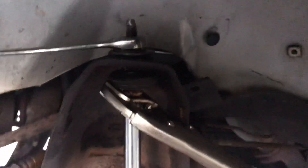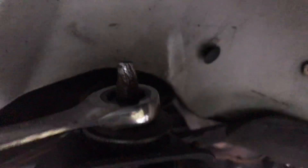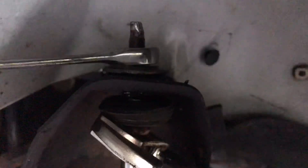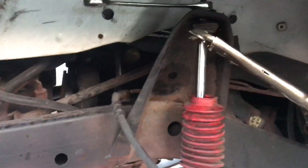So I just wanted to share that tip with you. If you've sheared off the top of your shock absorber like that one there, there is hope. Don't get the saw out just yet — try that method right there. Clamp it right around that flange, because that is fixed to the tube and that'll stop it from spinning around on you.